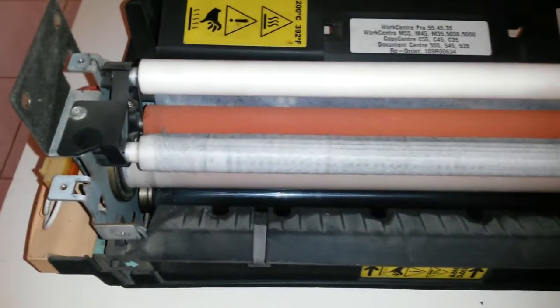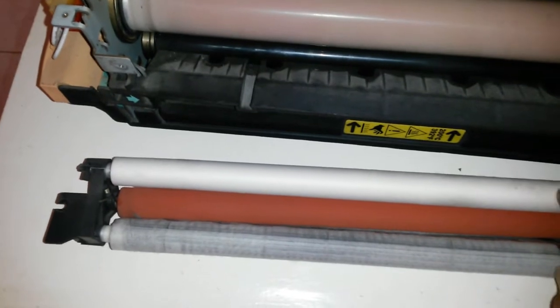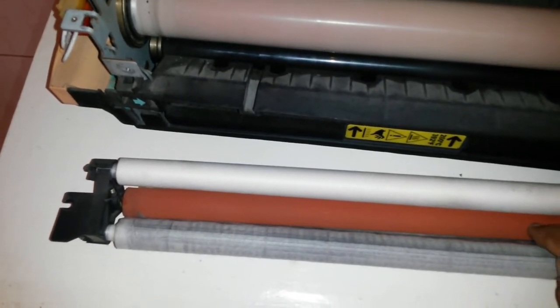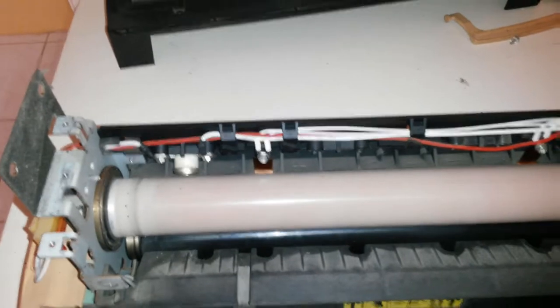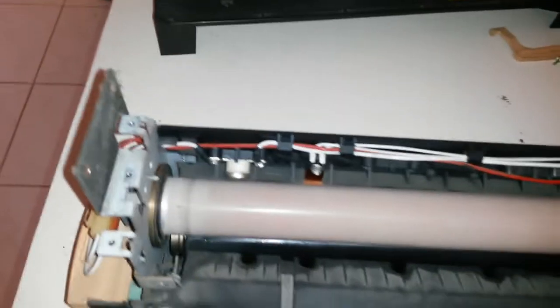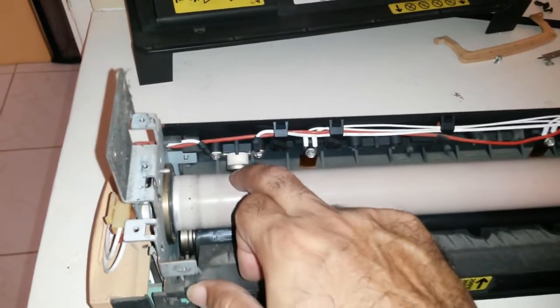This mechanism drives the system, and the synthetic material — not paper — runs from one roll, around this roller, and onto the other. I suspected it was going between two rolls; I just didn't realize this roller was involved. When you turn it, the material goes around and coats in between. This silicon roller appears to be pressing against the drum, likely applying a light coating of synthetic fluid — first guess is silicone oil, but it feels slightly tacky and oily.